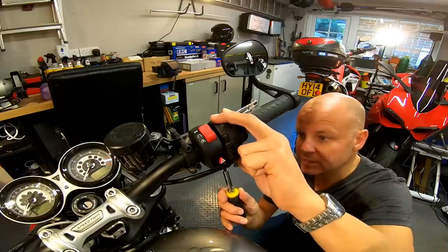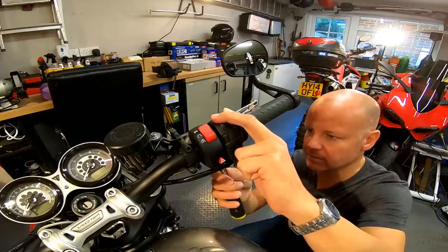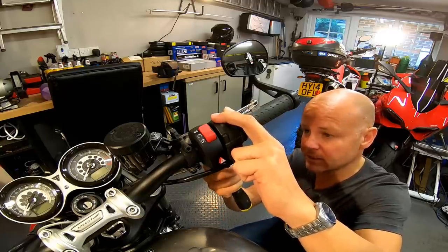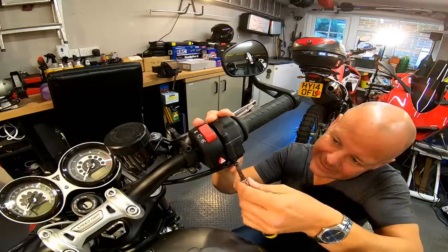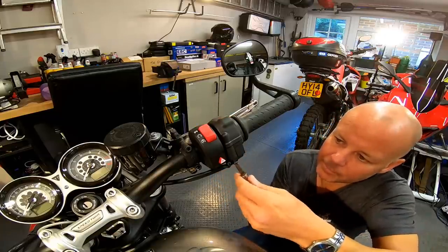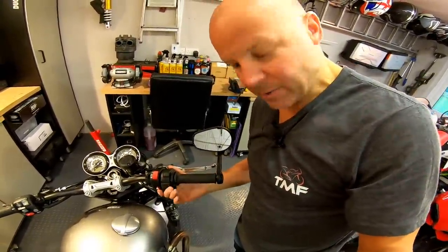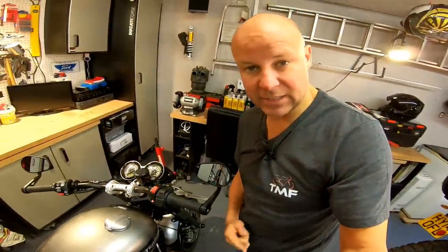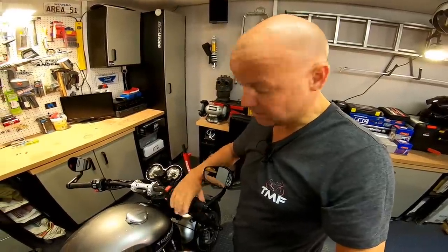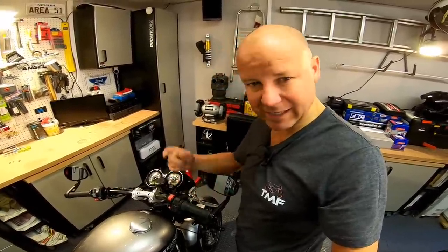Just while I'm doing this — the website is DucatiSpaces.com, that was the original website. They make them not just for Ducatis but for Triumphs too, various types. If you look at the description below, there's a discount code — use the code MissendenSK for the spacer kit and you can get 10% off. Definitely worth doing if you want to go down this route. All four screws tightened up. Just checking that it all moves okay, nothing's going to move around the handlebars — all good. And if you look at this now, when I move it there's none of that initial play. Just absolutely rock solid, exactly the way it is on my Ducati, which I far prefer. Bike manufacturers often put a little bit of slack in there purposely, but for me it just makes the bike way too jerky at low speeds. This is a great solution to that. Let's get my kit on and go and give her a ride.